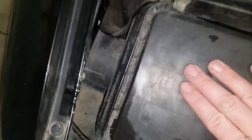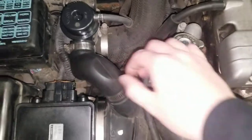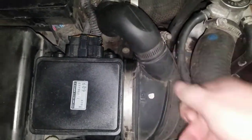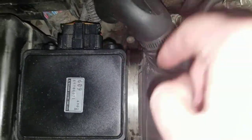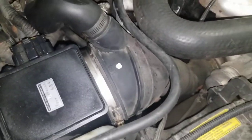So just to recap: take this tube out — you always got to take the airbox out for that, it's a simple job. You've got to take the intake off anyway because the tube that goes into the intake you have to cut. There's actually a write-up online on how to do this — I totally recommend if you're going to do it, read the write-up. Take the tube out, cut it — that's it.